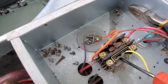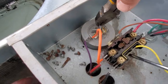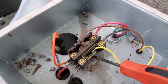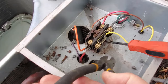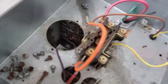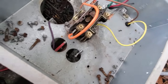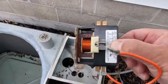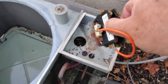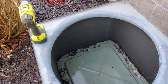While the cleaner is penetrating, I'm going to take this apart and remove the capacitor. I'll use my pliers and take the wires off. Take some good pictures so you know where they go. The contactor has two large silver screws on this unit — one here and one here — and the whole piece just lifts right out. Don't forget to take that orange jumper wire off because it does serve a purpose. I'll put both parts aside and when the new ones arrive we'll put it right back.